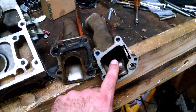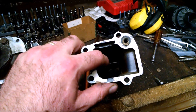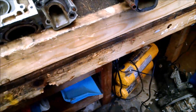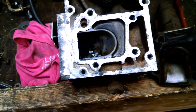Here we have two different kinds of exhaust. This is the old 9.9 exhaust — as you can see it has a relief right here and you can see that edge in there. Any time you get edges from where they cast it, it's rough in there. With the two-stroke, the sound waves bounce back and forth, and a tuned exhaust will shoot the sound waves right back into the combustion chamber right as it's closing in, which compresses the air and makes it run better. In an RC car you would refer to this as getting it on the pipe.